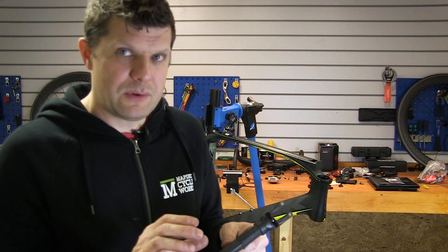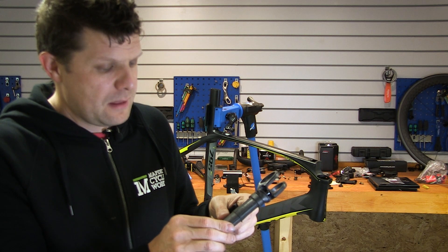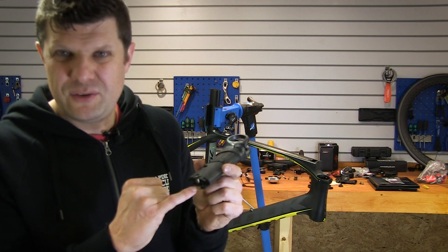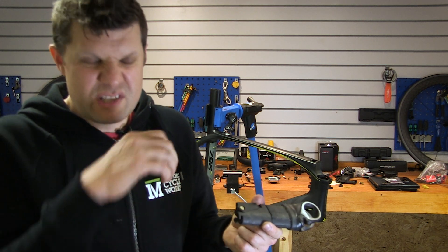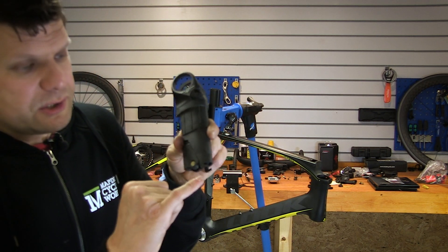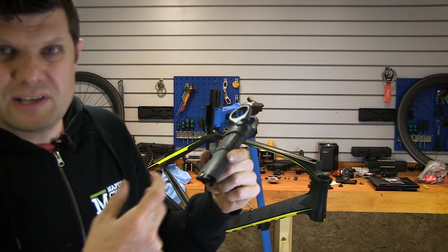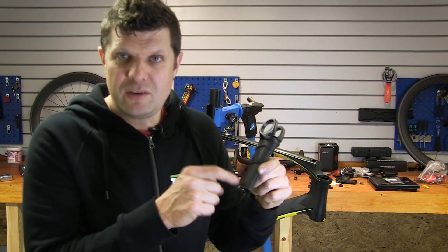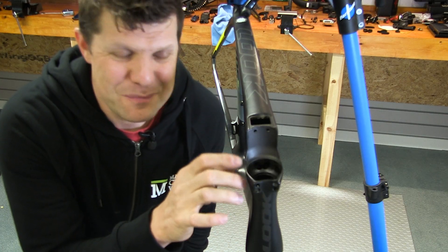As it stands we can go in with this absolutely solid into the frame. It's brilliant to see such engineering and attention to detail — most bike brands would use a steel or aluminium bolt where you get corrosion problems, but using a brass barrel bolt means all those details are thought about. Even down to the little hook on the end, which is designed to take a DI2 battery that just hooks straight in — no more trying to jam a DI2 battery inside a seat post. Not enough bike brands take care of these small details.